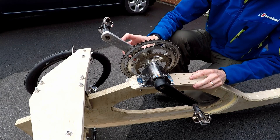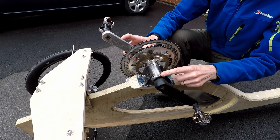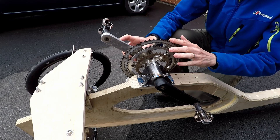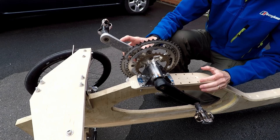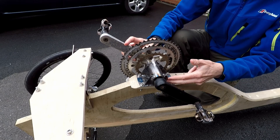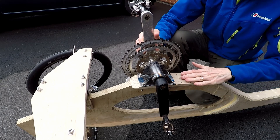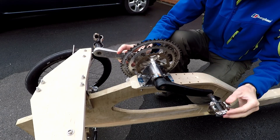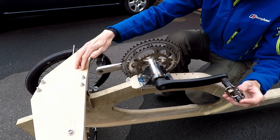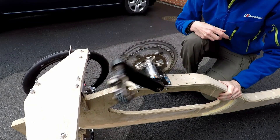Let's see how the bottom bracket mount has turned out. This is a British Standard bottom bracket shell which has the left-hand thread on the right and the normal thread on the left. The crankset I've borrowed from my Trek bike, so the big chainring is a 52 teeth ring. The bottom bracket shell is mounted to the frame via this 2mm steel fabrication, and we've got various bolt hole positions in the top of the frame so that I can move it forwards and back to give a bit of adjustment. At the moment it's fitted with SPD pedals. This is in the forward most position so there's a narrow gap between the pedal and the front swinging arm, but there is sufficient clearance. So this is all spinning nice and freely at the moment.